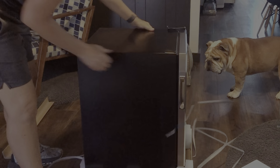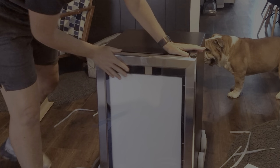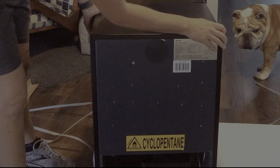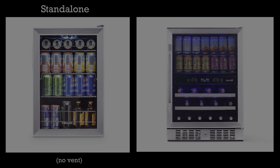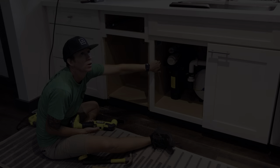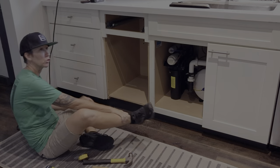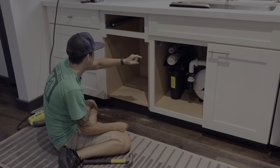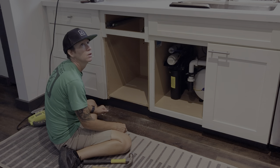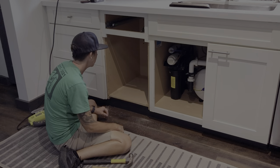You may have noticed that this is a standalone fridge. It's not intended to be built in. Therefore, it vents its heat from the backside, and if it isn't properly ventilated, it can negatively affect performance. We knew this going into it, but really needed the fridge to be super small, so we're going to make it work. We're just going to cut little circular holes throughout it so it'll be ventilated — just like with the hole saw. Just something to put holes so it gets some air. Makes sense.